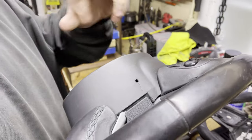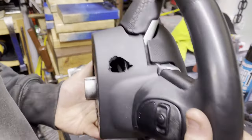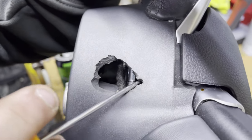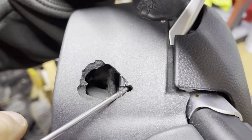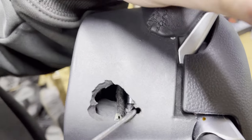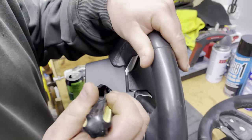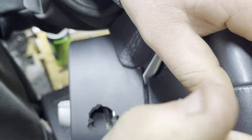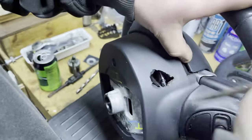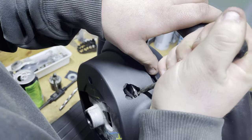Since this is technically the spare wheel now, we cut an access hole so we could see what we were doing. Essentially what you do is take a flathead screwdriver and get into this hole right here — there's a pin in there that you just push in, only about a quarter to half inch in. You want to have a smaller screwdriver than this, but basically you just push it into the hole and push down, and you've got to push it down.